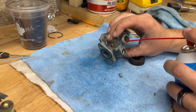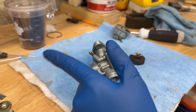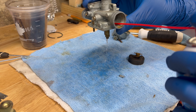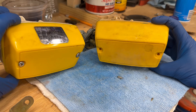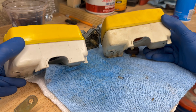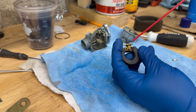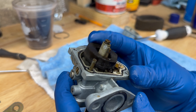Make sure all your ports are nice and clean — don't forget these two in here. Much better, much safer. When I was looking for a float needle, I found another original yellow air box — look at the difference: shine, no shine. You can just tell how much nicer this one really is. And trust me guys, anything that moves, it's very helpful to make sure it's properly lubricated. That float needle is working properly again.